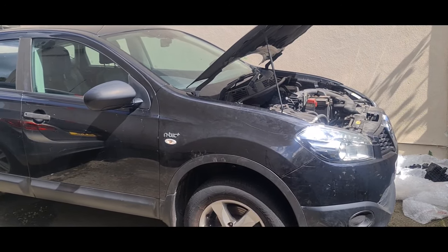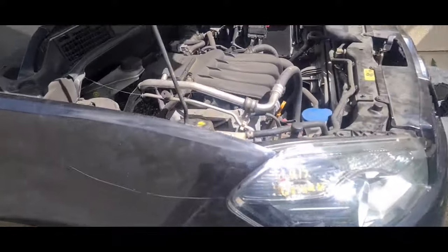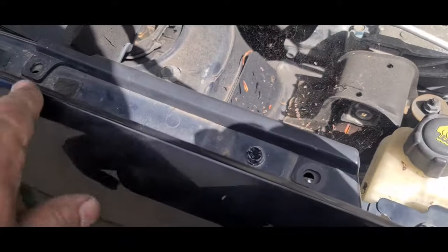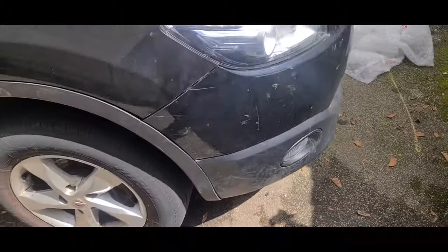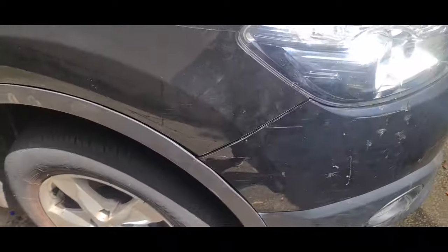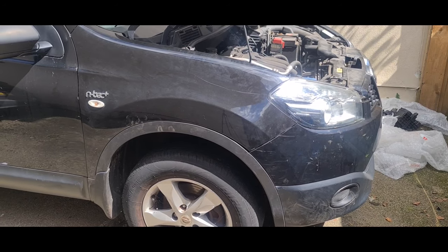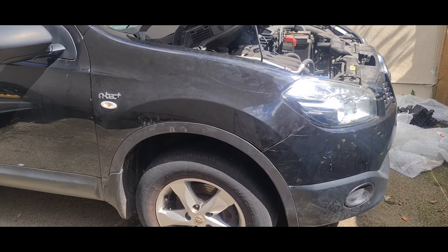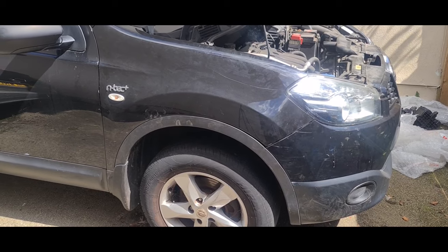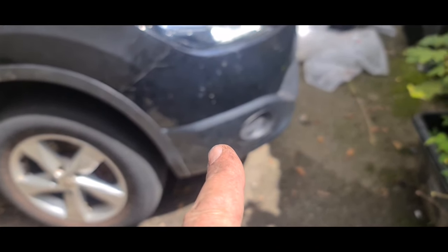Alright guys, we are done by the looks of things. Obviously we've got to do a huge clean-up, but as you can see: wheel's back on, arch liner's in, bumper's clipped in, wing's in, light's in, everything works. There's a bit of a faff in this top area trying to get these holes to line up. I've still got to find out where I can get some clips to clip this little bit of plastic in. Everything else is back in. I'm not overly happy with this gap here, but when you get a wallop in the front things do move. That little bracket I showed you — it's possible it's not quite in the right position, maybe a couple of millimetres either way — and that would then be perfect.